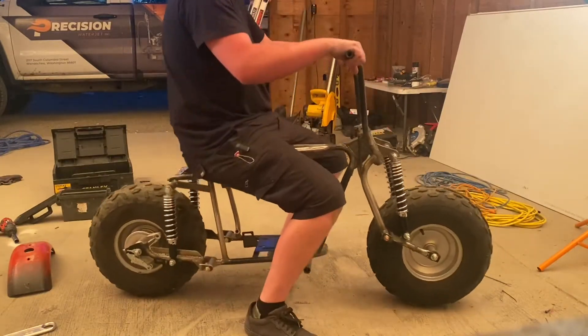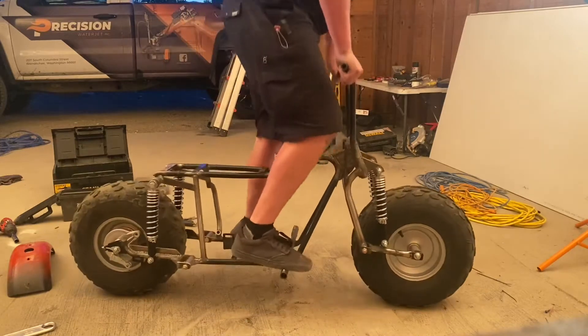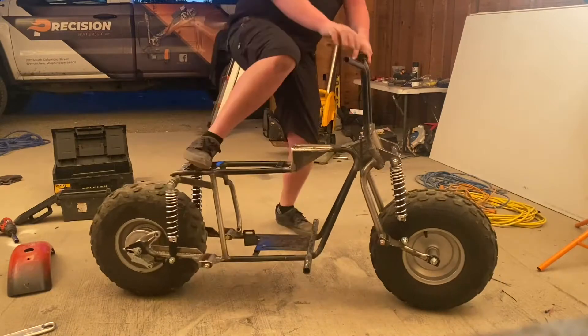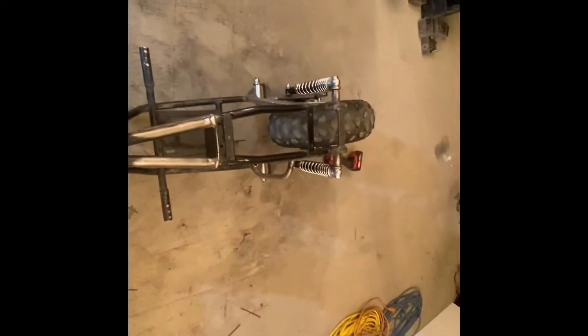Sitting on it with everything on the low setting - front fork I can just barely get it to bottom out, and in the rear same deal. It's lined up and doing well now - hell yeah, so gangster. I'm honestly so excited about having this thing together. It doesn't look like the rear end is lined up exactly the way I want it either, but that can be adjusted the same simple way. We have reached the point where I'm calling it done for now - I'm going to pull all the shocks off, get the frame cleaned up, grease all the pivot points, toss everything back together, and paint the ever-living shit out of it.